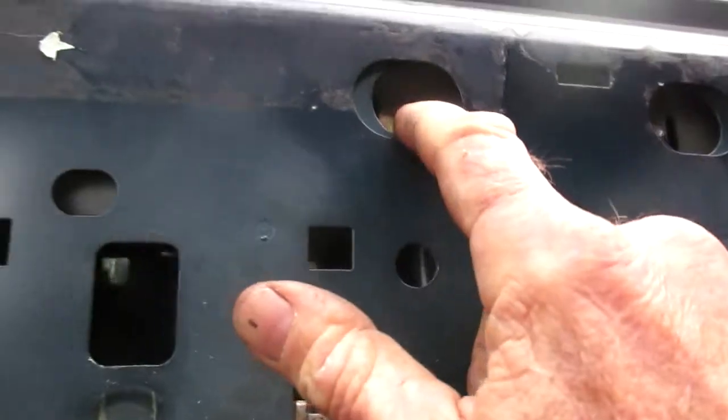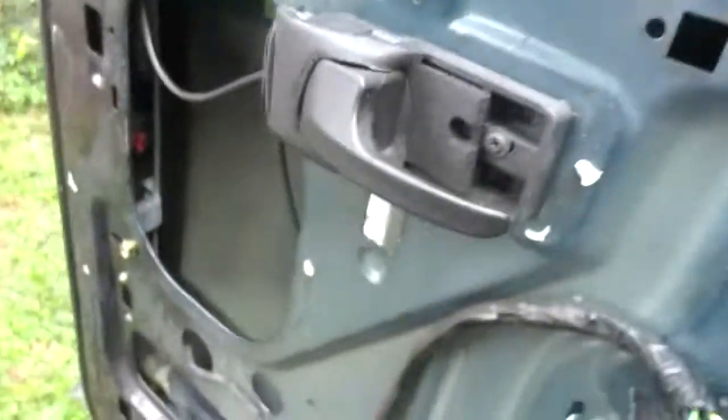Basically, what you're going to do is take out those 2, the 3, the motor, the connector, these 2 up here, and there's one on either side of here, and this little carrier is glued silicone to the window, so this stays put. Those little forks right there are going to hold that. They'll sit right in there. You bolt these in here. You can reach in here with a 10mm. I reached in through the other side over here, lift it up a little bit, and got that out of here. 11mm, 10mm down here again.